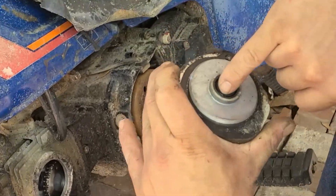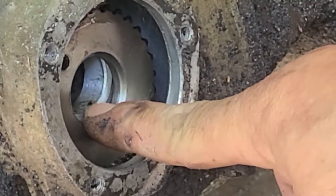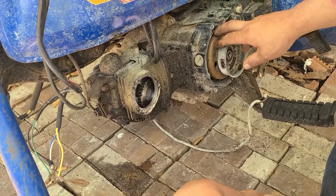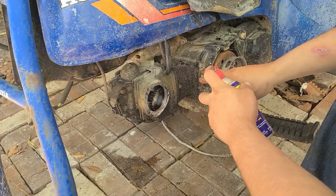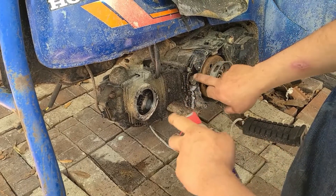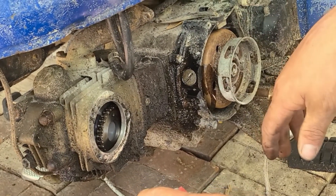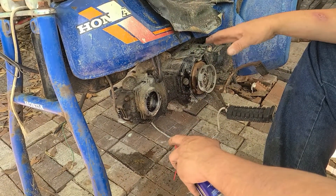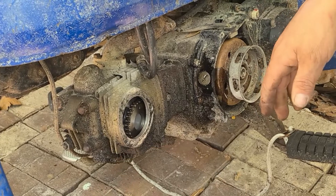See where they damaged that seal when they pulled the cam out. If you look inside, it doesn't look anything like the outside of the motor. I still feel like there's hope for it. Once we get it all nice and cleaned up, hopefully we can get a signal on it. I'm going to start off spraying this thing with a little bit of WD-40. I'm pretty sure it's going to be a booger to get off. I know a lot of guys say spraying WD-40 at a bolt or nut isn't going to work because you've got to have an air gap, but I've always had a lot of luck just wetting it with some WD — it gets in there and penetrates no matter what.